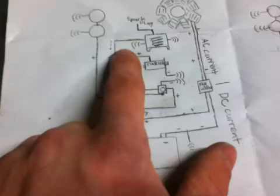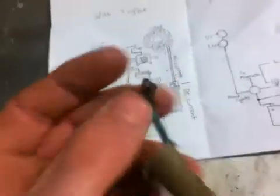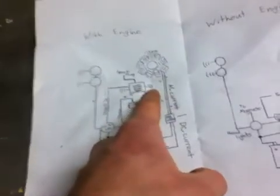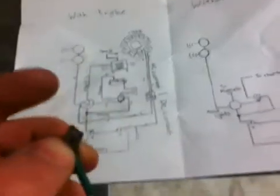These are your headlights here, and this short wire here connects to the magneto, which is underneath the shroud of the engine. When the engine is running, there's a negative current here. It combines that negative current and puts on positive current, which creates a short. When you create a short, you're not going to generate any electricity past that short, meaning you will not get any spark, which kills the engine and shuts it off.